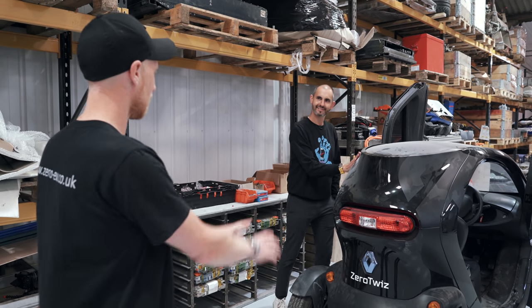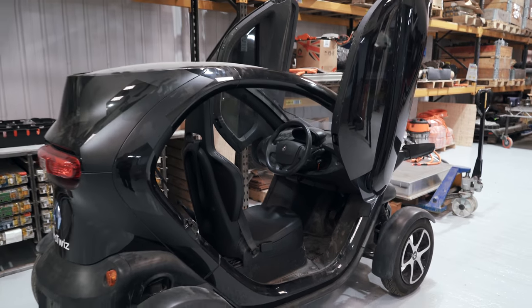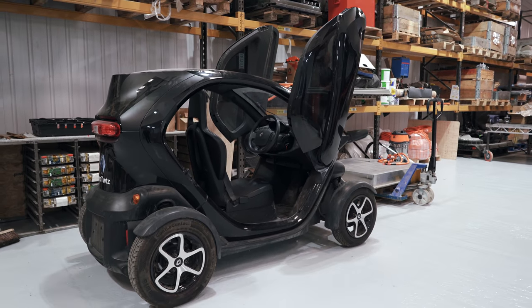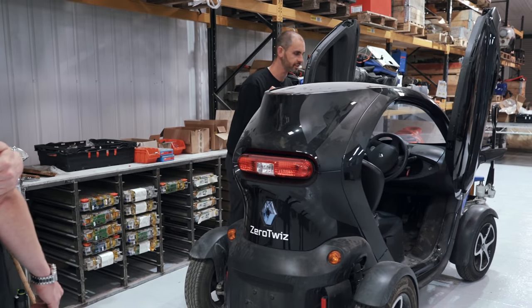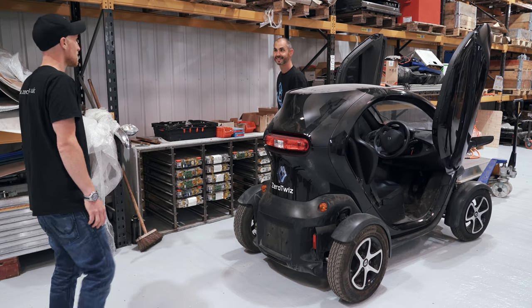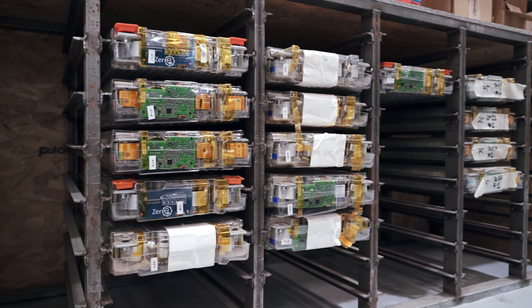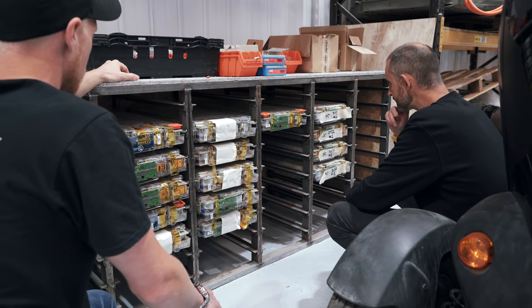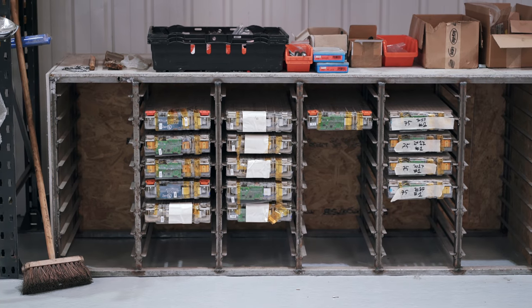Is this going to be a project? We've sort of started — Outlander rear motor in there, and a Golf GTE hybrid pack. That should just about fit — a hundred brake horsepower in that, and because it's not classed as a car, it's a quadricycle. These are Tesla batteries — still very desirable. The issue with doing kits is trying to find Tesla packs because everyone wants them: all the solar guys, all the little converters, everyone with the Hyper-9 systems. As much as they're really good, they're also really hard to get hold of in large quantity — which is why you're developing other stuff.